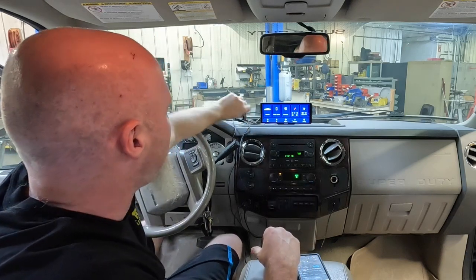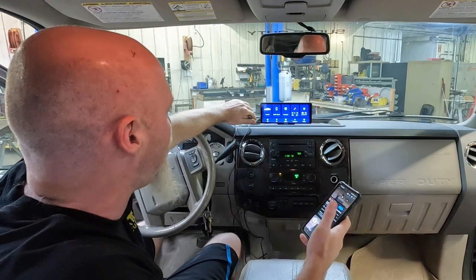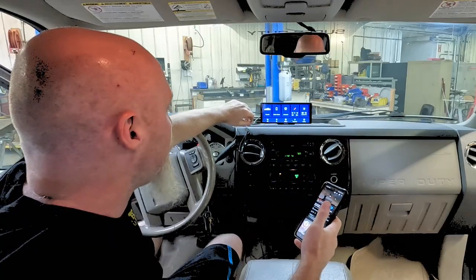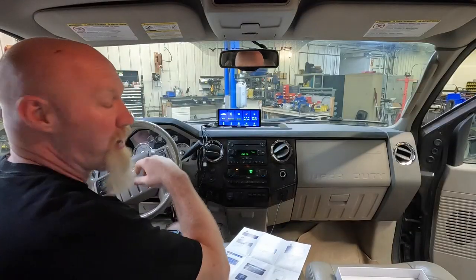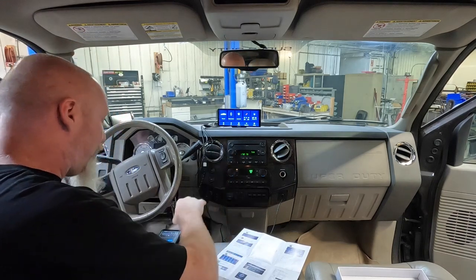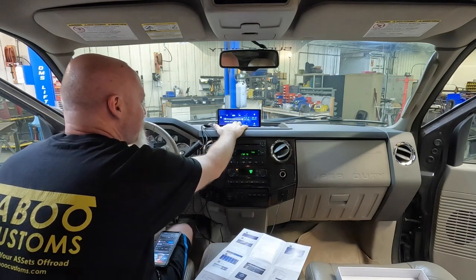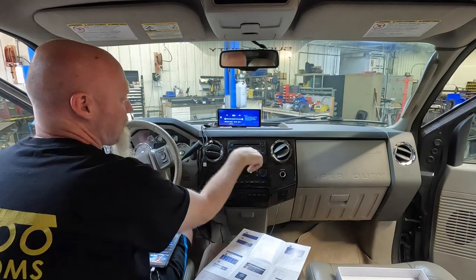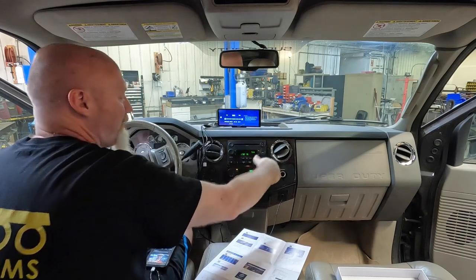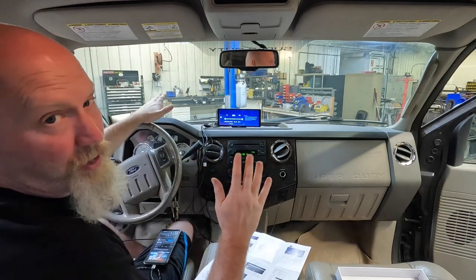What I might do is go try and get a USB cable and see if I hook it up with a USB cable, if that changes that or not. So anyway, let's try that. All right, I figured out real quick why it wouldn't work. You do get full audio through it. I had to go into this FM transmitter and change it to auxiliary. It was on speaker, which it still played through the car radio, but it had to be over auxiliary. So anyway, it does work well.